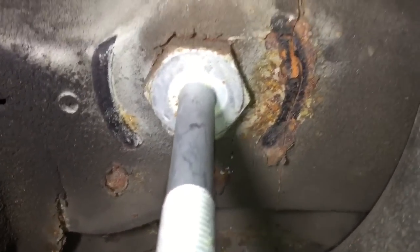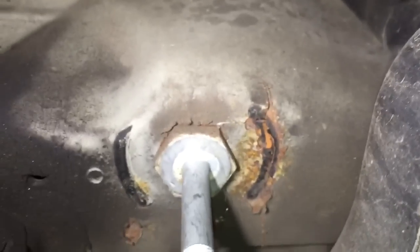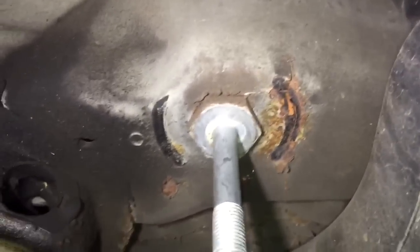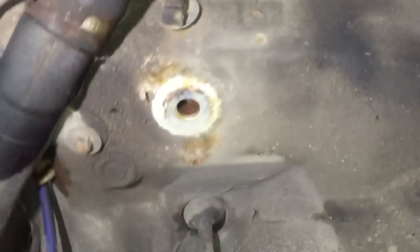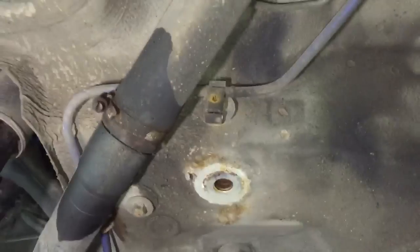A couple of spot welds that are showing signs of movement, and what looks like a crack between the mounting pin and going across to the spot weld. That one needs looking into, obviously, and repairing. We haven't seen anything obvious yet on the right rear until we start degreasing and taking all this off.